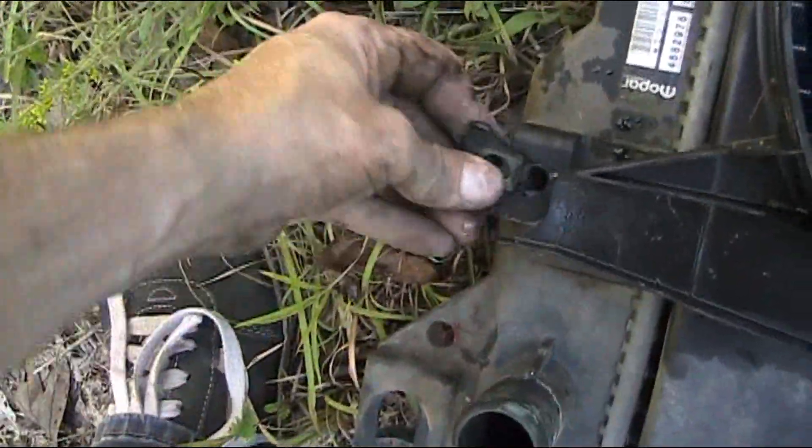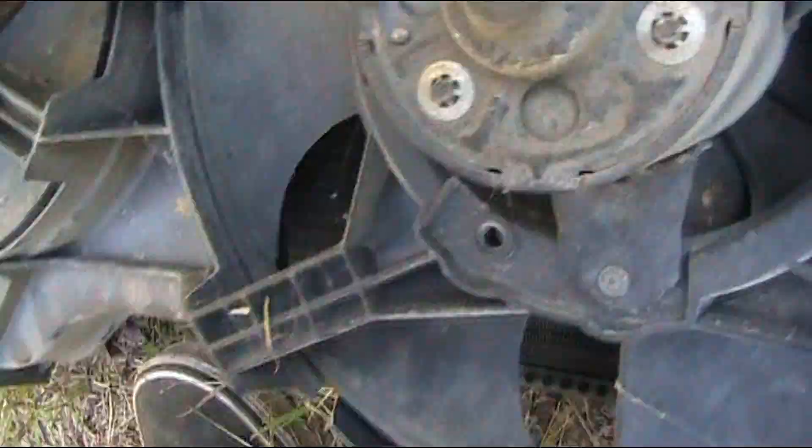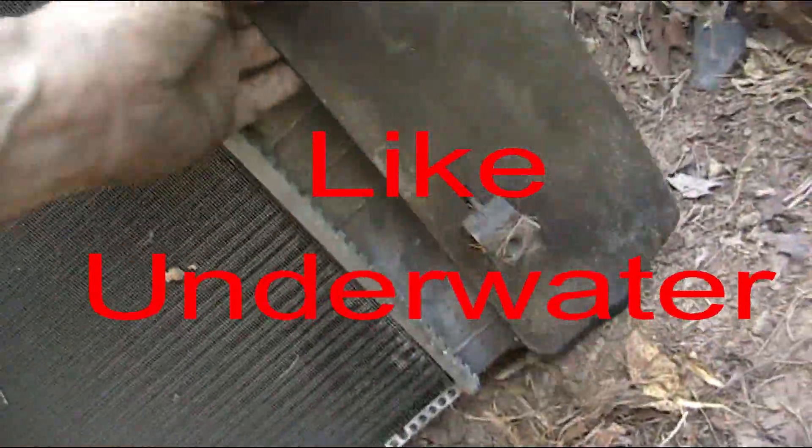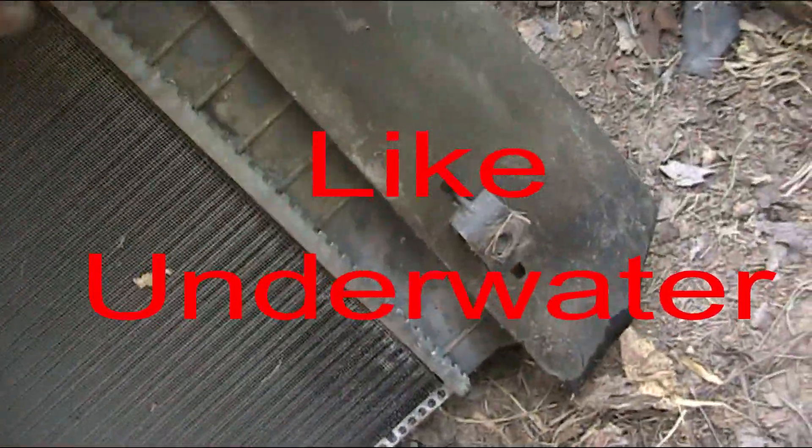It's up now — disconnect it from the fan here so I don't need that. Now we got it ready. Check the tanks for cracks, check the coils for holes. You can even shoot air in it and make sure it doesn't bubble out. This one looks good.